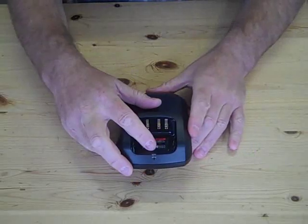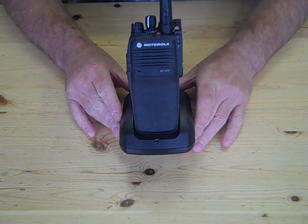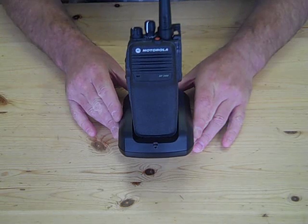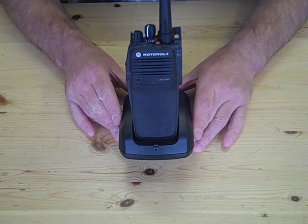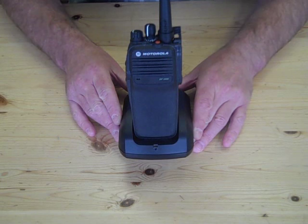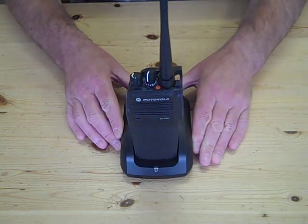As you can see from the front there's an LED indicator. You would pop your radio inside there and an LED would come on. When you initially put power into the charger you get a single blinking green — that just indicates there's power to the charger. You then insert your battery and radio into the charger and the LED goes red, indicating the battery is charging. When it changes to blinking green, that indicates it's 90% charged and going into a trickle charge known as a top-off charge. When the LED goes steady green, the battery is fully charged. The only other indicator to know is blinking red, which means the battery is unchargeable or not making proper contact.